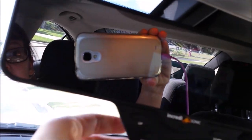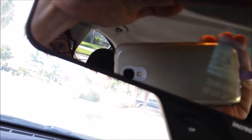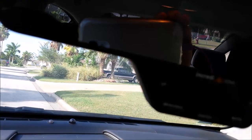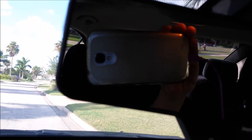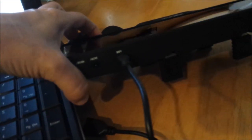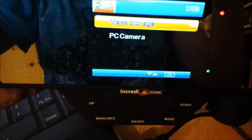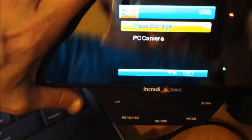So I'm going to start recording. My light's flashing there, even though you can't see it. I'm going to go around the block, and then I'll plug in the adapter from the camera to my laptop and we'll see what we get. I plugged the mini USB cable into the top of the camera. Now I'm going to plug the other end into my computer — this is Windows 10, so hopefully it will detect it and add it just like a regular camera. It comes up and asks you: mass storage, or do you want to use it as a camera? I'm going to press the menu button once to select it as mass storage.